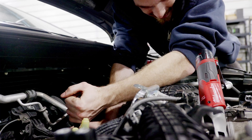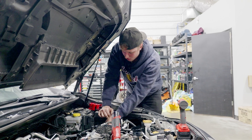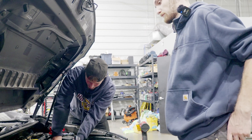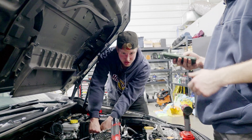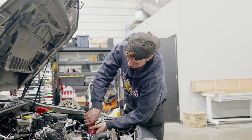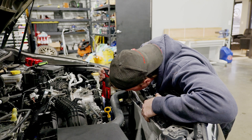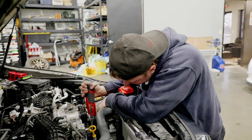If it's this one — which is normally the one that does it — I'm okay with breaking it off in the block and just not using one of the bolts, because these transmissions have a notoriously large amount of bolts and they're not making much power, so it's not a big deal. Ideally you'd like every single one, but if you're missing one it's okay. Ninety percent of the time when we're doing these pulls it's because we're swapping the block, so it doesn't matter if it breaks off. I'll just order a new one. This one I have to save. Lots of back and forth, lots of WD-40.